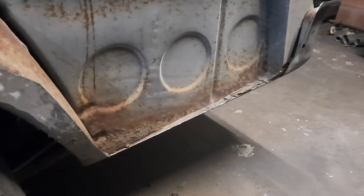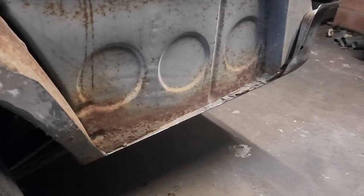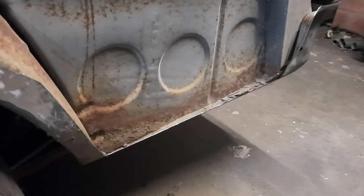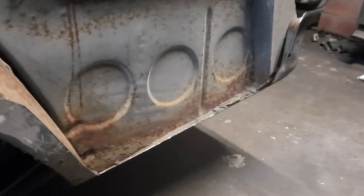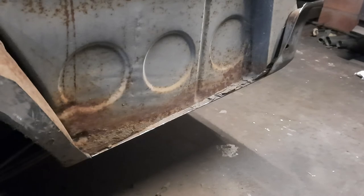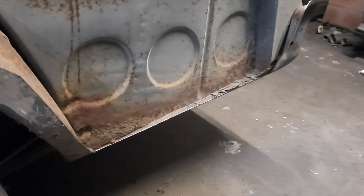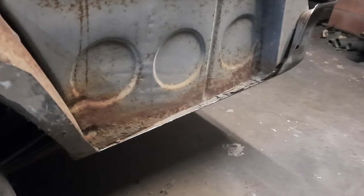It's going to be a pain trying to weld upside down. I'm considering whether to actually cut off that panel as well — but it's probably better not to, probably better to just persist in trying to weld it from underneath. You're only doing plug welds, not a solid bead anyway.